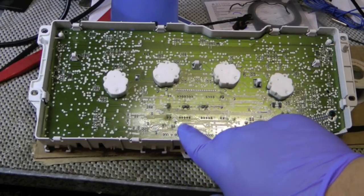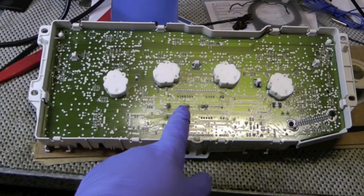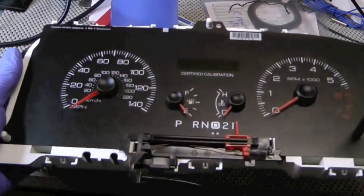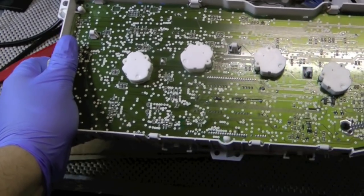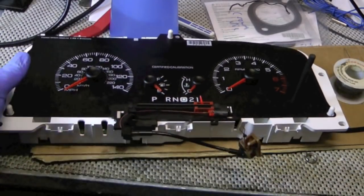It's hypothetically possible that your resistors could actually go bad and that it's not a soldering issue on this end. If that's the case, it's a little more complicated because you're going to have to desolder these points, remove this side of your gauge pod, and pull those resistors out from underneath the display port, then put new ones in and re-solder those.